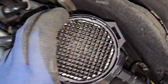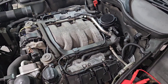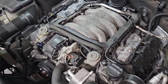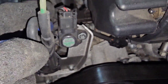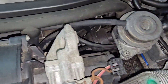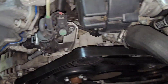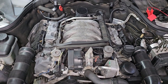It's seated pretty good, so we can now put everything back. Just make sure to check all of these plugs for the coils. Also, it's a good time to check your solenoids for the EGR valves and these vacuum lines as well, because you don't want to get a vacuum leak on those ones. These are looking very nice and tight, and at some point we will be back here replacing those as well.